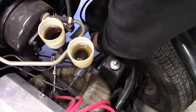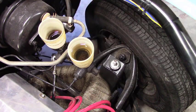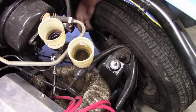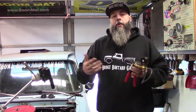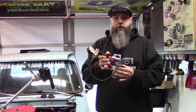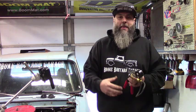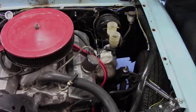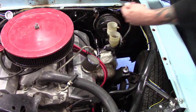The rear reservoir turned out to feed the front brakes, so we pumped it dry using a vacuum bleeder with an inline tank. Now we can actually take the line off without making a total mess. The reservoir has been sucked dry and the brake line has been removed.